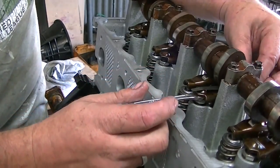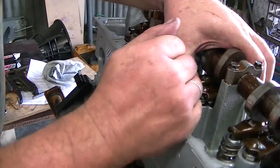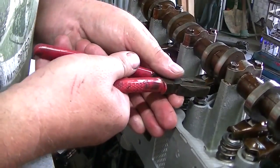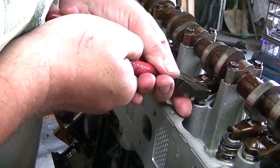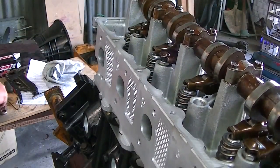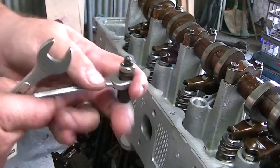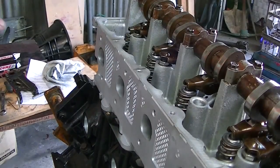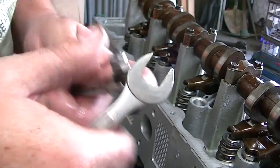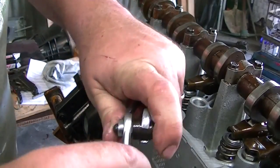I loosen and tighten until it's about right there, then I pop it off with a little pair of pliers — careful not to do any adjustment. I pull it out and I want to lock it into position. I grab a spanner onto the valve lash adjuster and lock that with my other hand so it cannot move, then I tighten the lock nut into place.